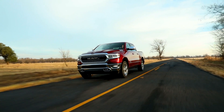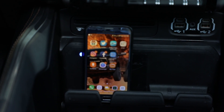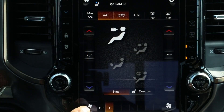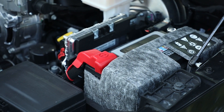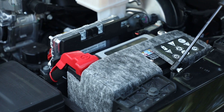At highway speed while cruising, with the radio and interior cabin comfort functions on, those parasitic components typically provided through the alternator are uniquely managed by the eTorque system. The 48-volt battery can charge the 12-volt battery independent of the motor generator unit functionality.